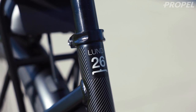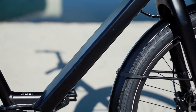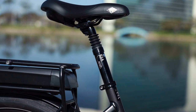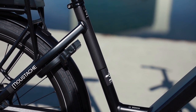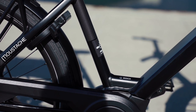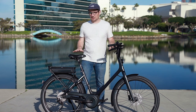When you first look at the Lundy, it's really clear that this bike is something different and unique. The frame has this really low step, and you might get the impression that it's not going to be that stiff, but actually that's the furthest thing from the case. The way they designed it, it uses a special tubing that only they use. Inside the rectangular shaped tube there's a round tube and an X cross brace, which makes it super stiff — really ideal for this type of bike. So you have that ease of stepping in and out, but you still have the stiffness of a traditional triangle frame.